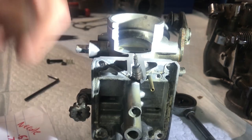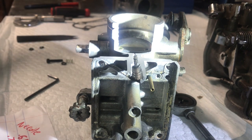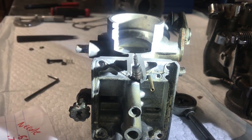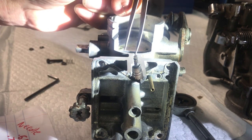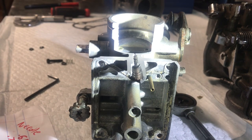I hope that helps someone understand why you can't just set a certain number of turns on these carburetors. Unless you were the only owner and always took care of them, or it's the first time the needle's been adjusted, the seat could be damaged. If somebody rammed it down hard, that burr goes all the way around, blocks the port, and your adjustment is thrown off. You just have to keep playing with it until you can get it dialed in — hope that helps, and thanks for watching.